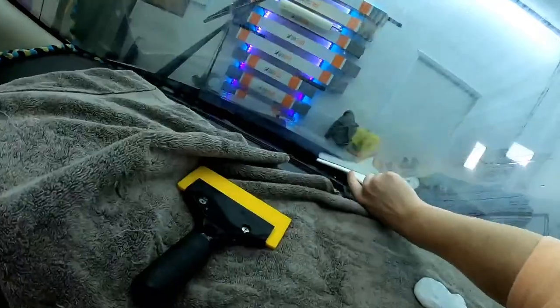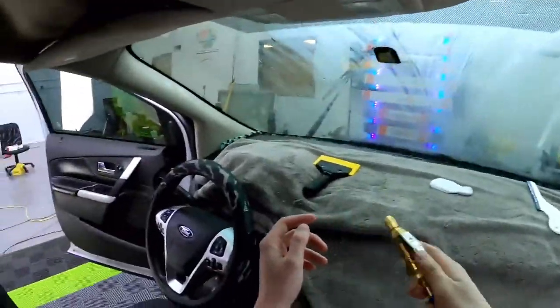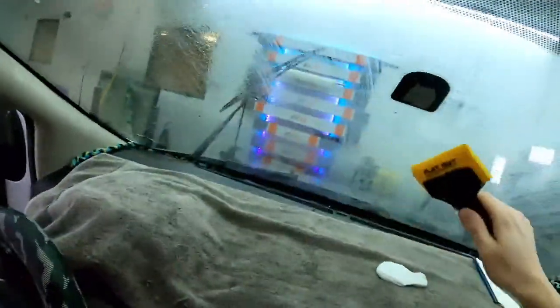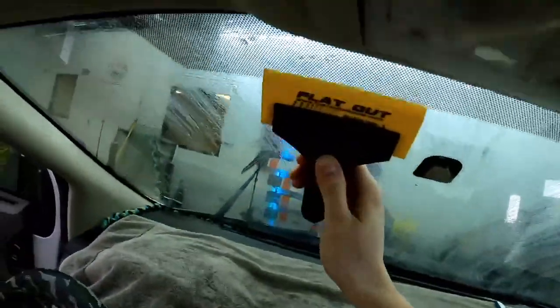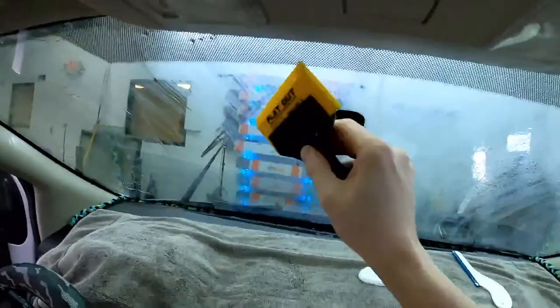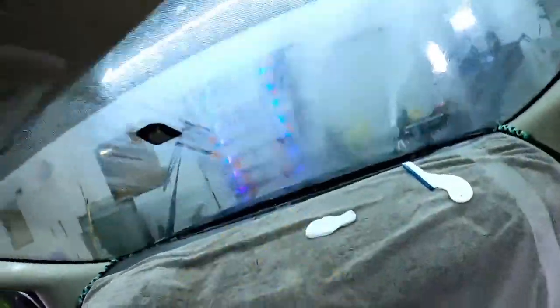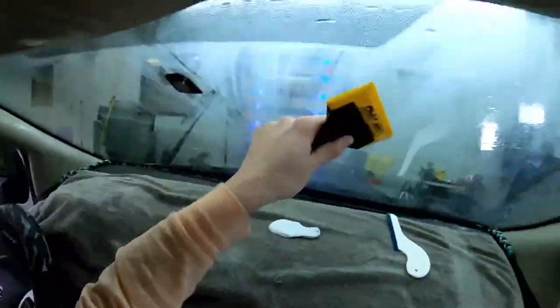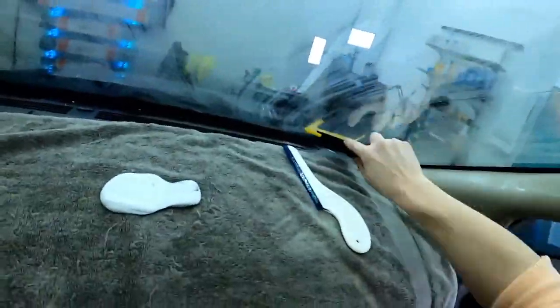That's why I like side swipes right there. Can I show the shrinking later? Not really. Not with this one. We'd have to try and get ourselves a different windshield. It's always about just keeping your shrinking even. Just work up the material as even as you can. If you over shrink something, that's when you get those tension lines you were talking about.